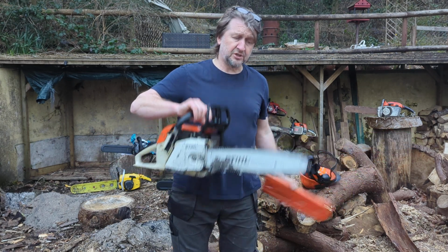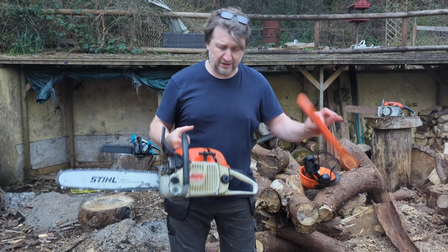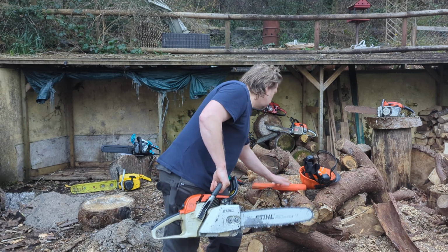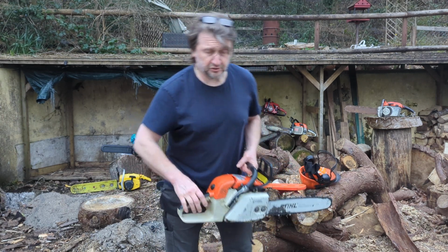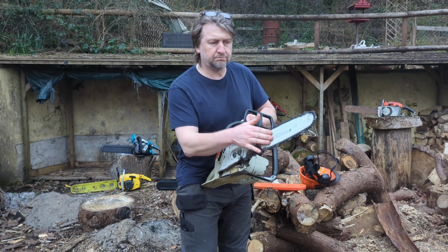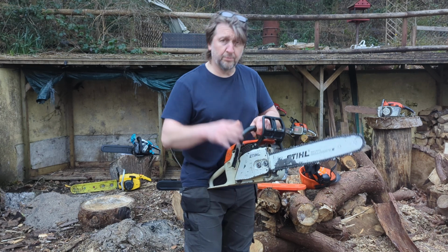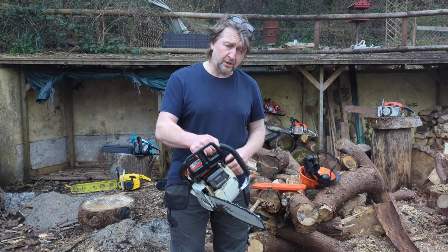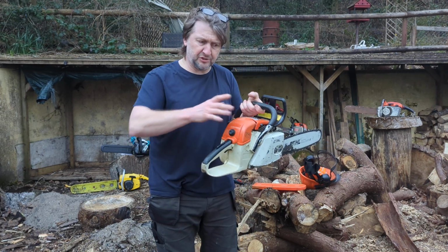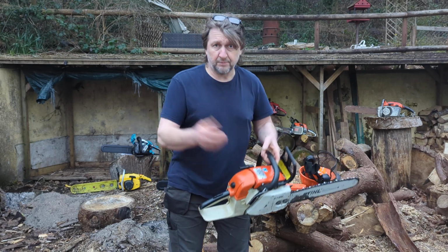Absolutely beautiful condition. So this one's running a genuine Stihl Rollomatic bar, brand new full chisel chain, all magnesium construction for the main components, composite for the tank, excellent AV. This one's never taken a disc. Running wise, it's such a beautiful saw. So what did this have done? Other than a really excellent bar and a brand new chain, it had a replacement clutch drum, clutch bearing, a replacement oil pump worm gear, and a correct HU carburetor kit, because they were ones I was investigating going back several months because of the variations of the carburetors. So I wanted to make sure if I was supplying the kits that I had the exact kits and fuel pickup, etc.